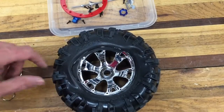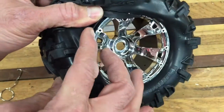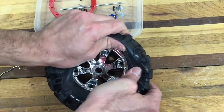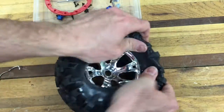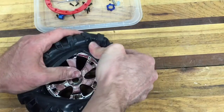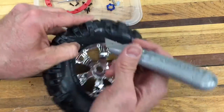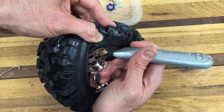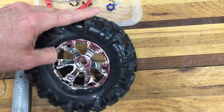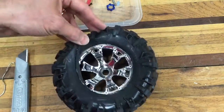I'm making slow progress here. The wheel has been super glued, and there's this groove right here that the tire fits down into, and so in places it is very difficult to get out. It's almost like taking a real tire off a full-size vehicle — kind of break that bead back — and it's forcing that super glue to let go. In tough spots, I actually have to take this knife and very carefully go right up against the edge of the groove while I'm pulling away, and that may release it as well. Just going to have to take your time on this.